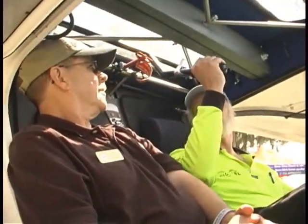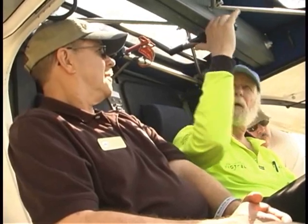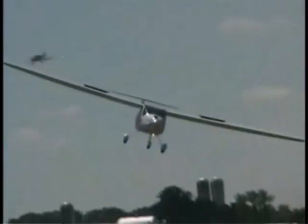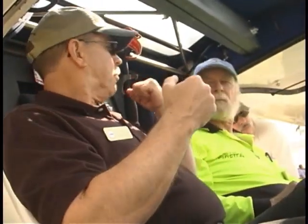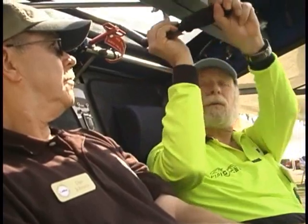That gripping black handle between the two of you — that's the spoilers. Gliders soar so well that you can sometimes gain altitude in the traffic pattern, so you need the spoilers to get down. It's kind of like an airbrake — similar to what you see on an airliner on landing, it deploys a surface on the top of the wing to kill lift. With such a long span making lift all the time, these are hard airplanes to get down — but you deploy the spoilers and work them almost like a brake, using them to control your rate of descent. It'll go 1,100 feet per minute down or as little as 200 feet per minute.